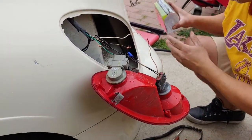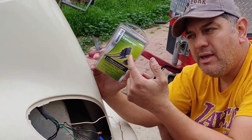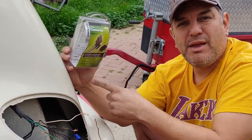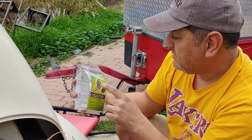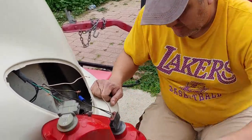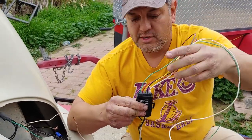I went out and I purchased a vehicle converter — about $24, it was $23.67 actually, at Walmart. I was looking for it all over the place and didn't even think of Walmart having it. I went on the website, put in this particular converter number, and it gave me a link to Walmart. Amazon sells it too — I'm sure Pep Boys, AutoZone, many places may carry this. It's from Hopkins. It's a vehicle converter and it's a four flat, number 48895. It's pretty nice because it comes with a little converter box — it's going to take my five wires and convert them into four wires for the trailer, for independent lights and combined lights.